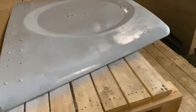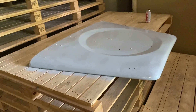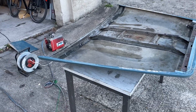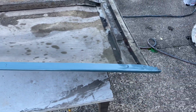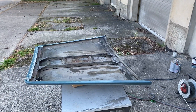I'm going to give it a couple of coats of undercoat, maybe rub it down, and then put some top coat on. I masked it up at the front with a bit of cardboard along the edge just to get the edges. The compressor isn't working that well, but it's not looking too bad, so I'm going to flip the bonnet over now and paint the top side.